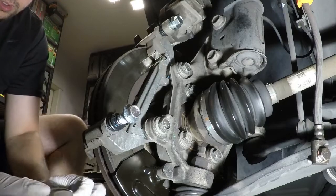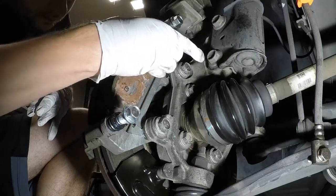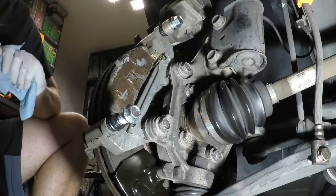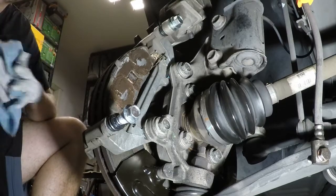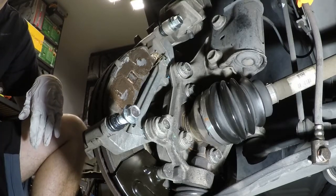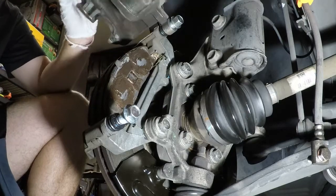So that's good. There it is. So we got both done. So now we have both brake pads in. I already decompressed the calipers, obviously, or pushed the pistons in, when I was actually taking the caliper out. So that's pretty much it right there. Now we're just gonna close it and then we're gonna connect the guide pins. And we'll have to obviously connect the banjo bolt, but again, that's kind of the next step.